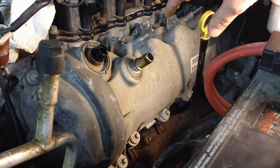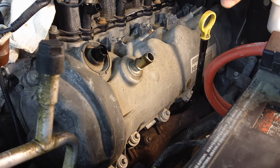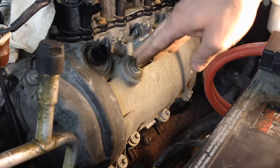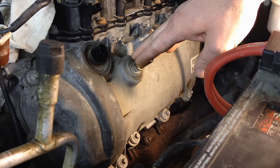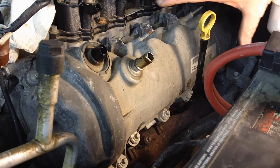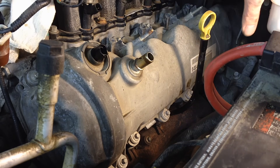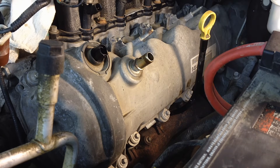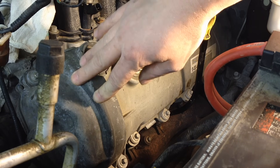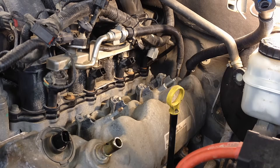Torque sequences are in the description below. For the 4.6 liter three valve, it's been the same all these years — 10 bolts in the valve cover. The early 5.4 liter three valve engines had a 15-bolt valve cover, which was a huge mess with bolts in the back that were hard to reach. Then in 2008 they went down to a 10-bolt valve cover that was a lot more robust.